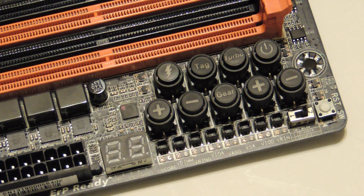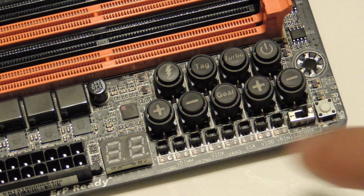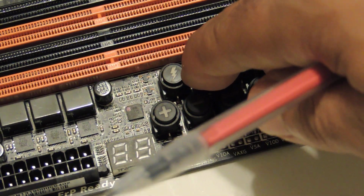The memory will be off. But the PCIe slots will be powered, meaning that you won't lose your data on something like an iRAM. It also means that you can test your water cooling loops if they have pumps that work on a fan header, or if they have pumps that work on a Molex connector. You can actually test the PSU, have a load on the PSU, and not be afraid of breaking your power supply. Okay, so that's really what OC Ignition is all about. It's a pretty useful function.